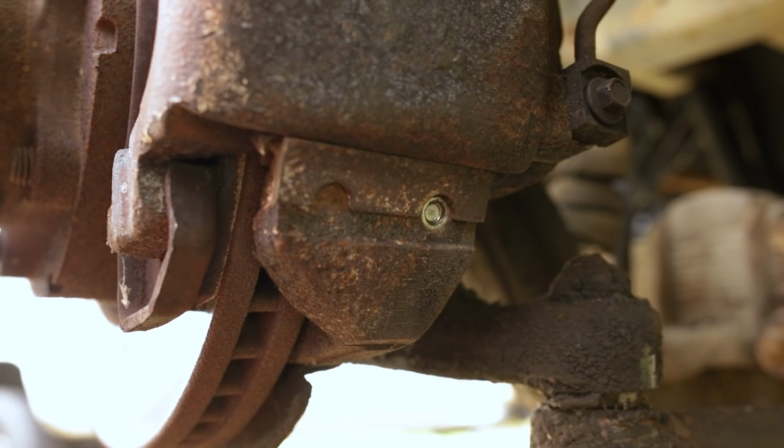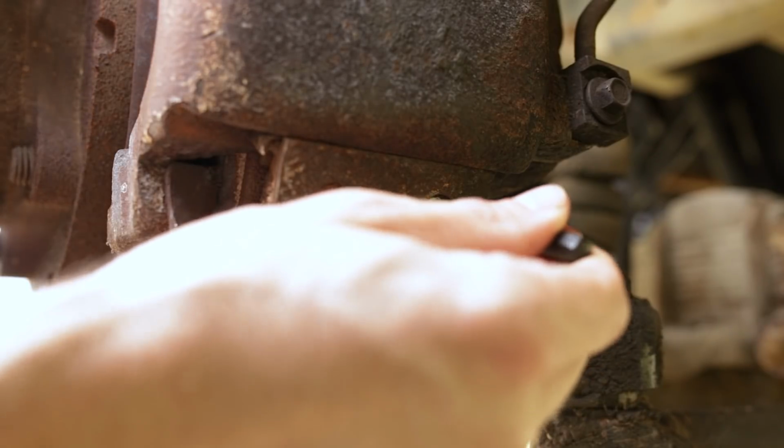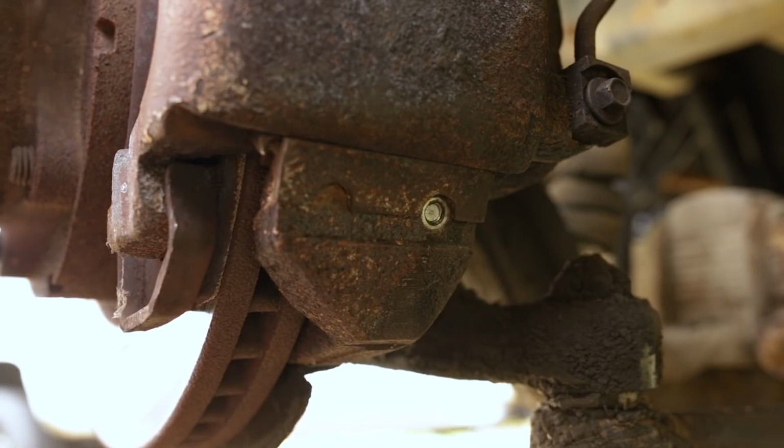We're going to be using the Mac 7-piece advanced R.B.R.T extractor set for this. Try them out. Haven't tried them out on camera. I've tried them on other projects. So let's see what size we need. Probably going to go with a number 1. The number 2 is probably a hair big.